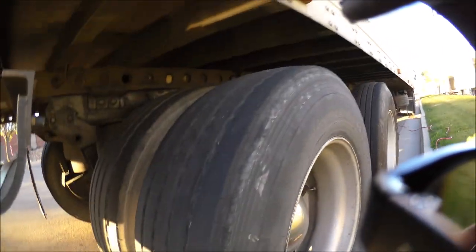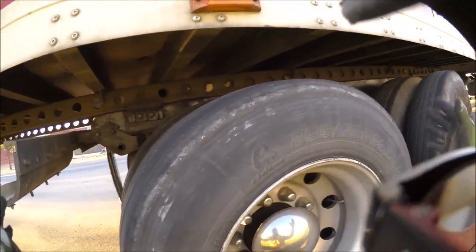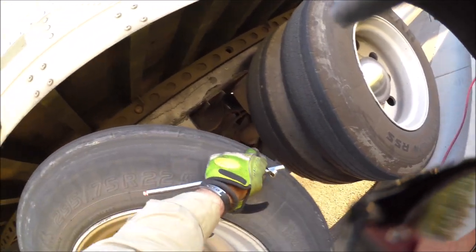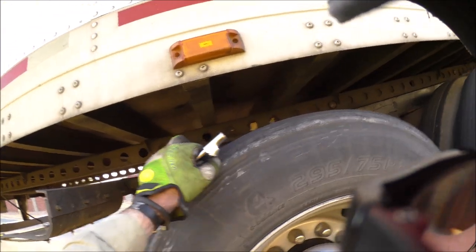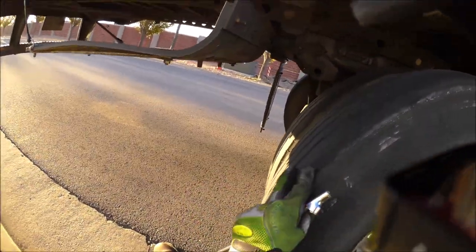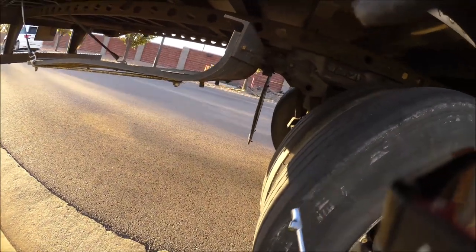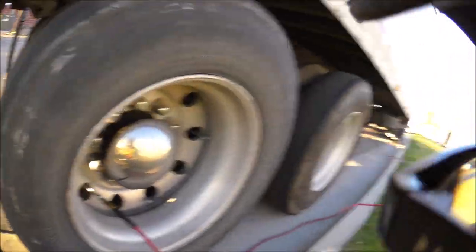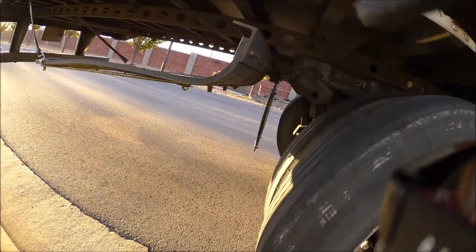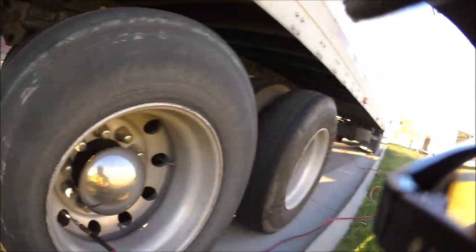Now they've got a new one - they actually stretch it out, wrap it, and slap it on like a rubber band, so there are no seams all the way around on this retread. You'll see it says retread so police officers can check. You cannot have retreads on a steering tire. With drives and trailers you can go retread. A lot of guys that love their trucks prefer retreads only on the trailer, not on the tractor, but you can use it all the way around.